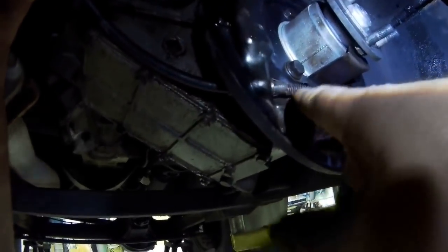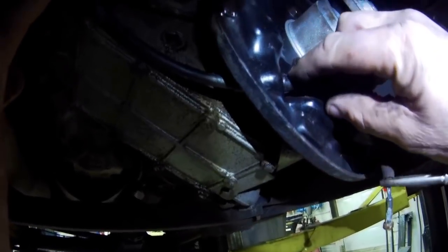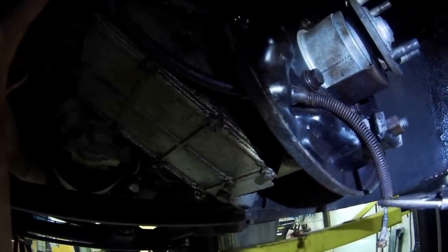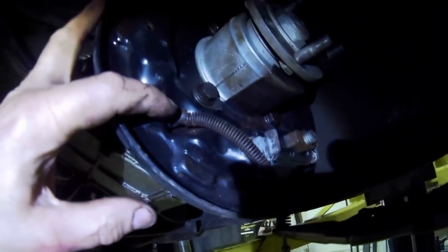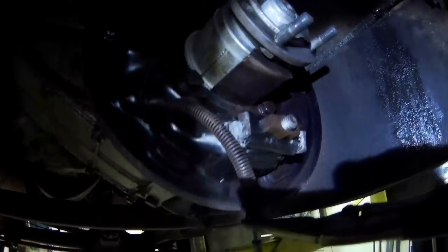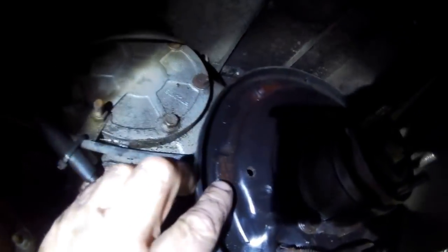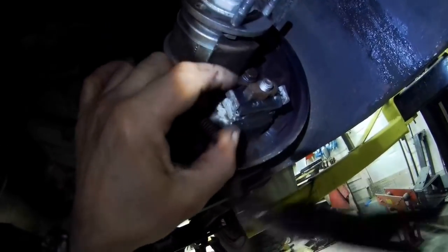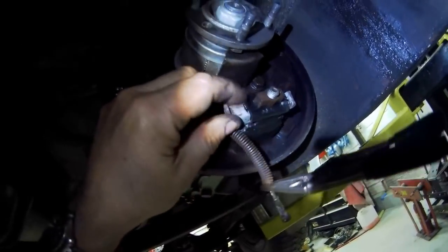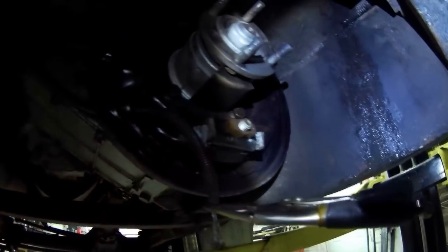Obviously sometimes you don't need to take that cable out — it would be easier to do this on the bench, believe it or not. So what I'm going to show you now is where we're going to lubricate everything up before we put it all back together. You can see here the pivot points — the raised points where the shoes touch. I put some aluminium grease on there, but I'm a bit disappointed in that stuff — it dries out, it's not a very good lubricant. So I'm going to put some copper grease on these points and then we'll come back.